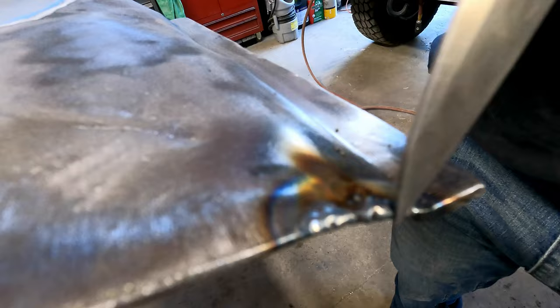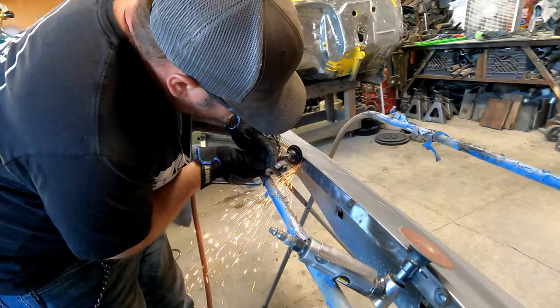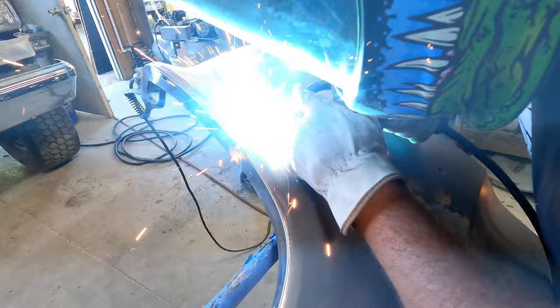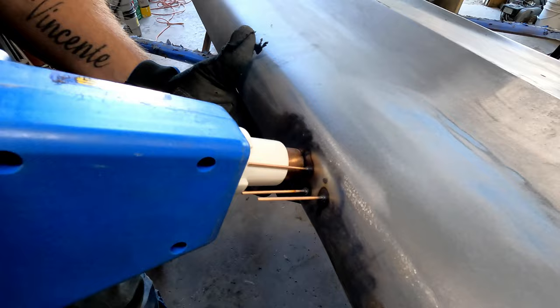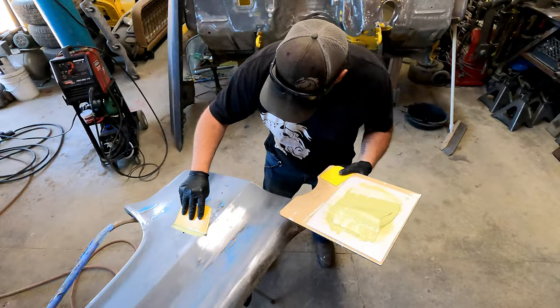It's great how you can grind it down — it looked good, all bent in, but you couldn't get it unbent because of the way that edge is. Jason is grinding out all the welds and smoothing up all the imperfections. Here we have a larger hole to fill, so we cut out a small piece of 18-gauge steel and shape it to fit directly into the hole, with a magnet holding it in. Jason welds that, grinds it off, and makes it smooth. Hammering out the flange, flattening everything out — there's a dent in the top of the fender so Jason is applying studs with the stud welder and then he'll put the slide hammer on them to bring it out flat.